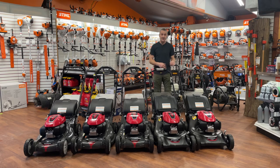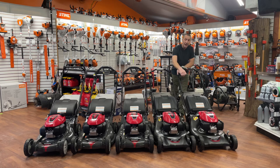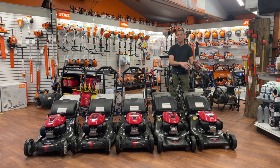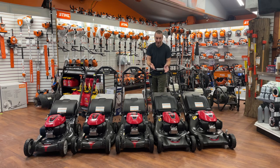From there we move up to the VKA — the HRN 216 VKA is a variable speed rear wheel drive. On this mower, I pull the blade control lever back, pull the rope, it fires up, I push the paddle down to my desired speed and mow the lawn. When I let go of this lever — the proper term is bail — every time I let go of this bail, it dies.